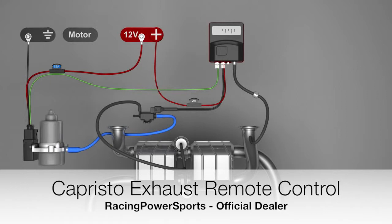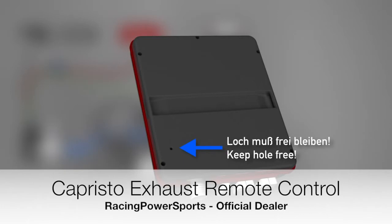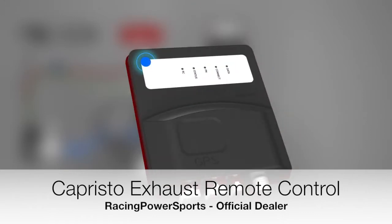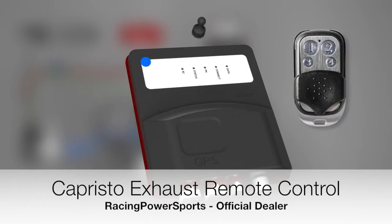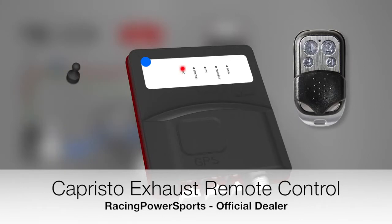Five things to consider during installation. First, the rear of the CES-3 housing has a ventilation hole for the internal pressure sensor. It must not be closed under any conditions. Second, this area of the housing must stay accessible in case a key fob has to be registered or erased. A hidden reed switch is located here. When a new key fob has to be registered, quickly wipe this spot with a magnet. The RC LED on the control unit will light up.